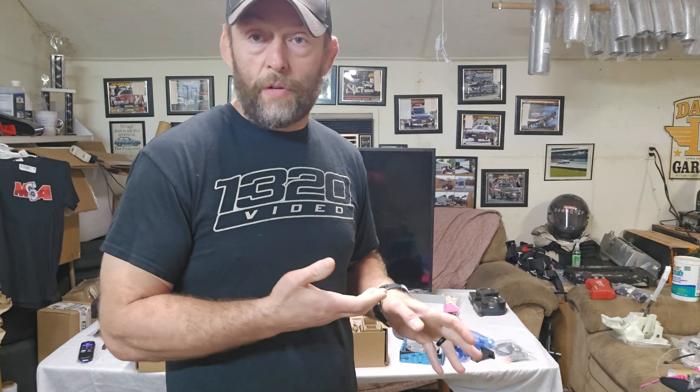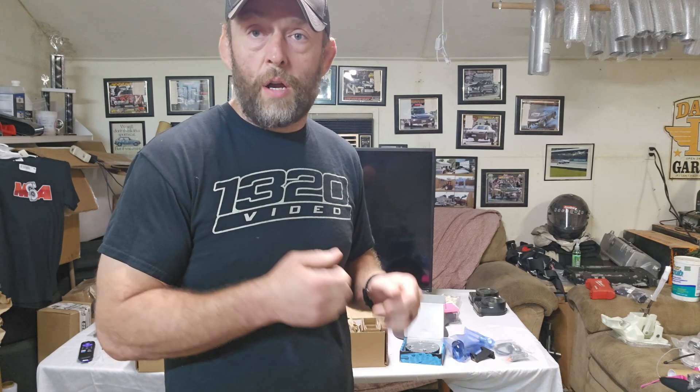Those things are pretty simple — you understand how they work now. It just gets engine position in the easiest way. Everything is serviceable so you don't have to worry about distributor failures anymore. We're going to go through how to sync this thing up on the car. If you buy a computer or anything from us, or pay us for a base map, I'll have this set up for you. When I go to tune the car I still always stick a timing light on and shoot the timing no matter what — I always shoot it.